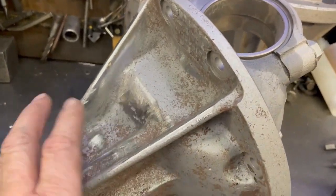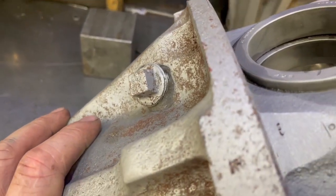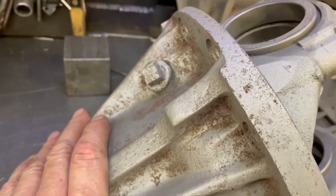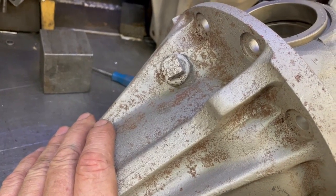We've got a different set of plates for these. Another difference is that somewhere here we have a filler plug. There are different types, but this allows you to put oil in the diff with the diff in the vehicle, without having to go through the filler plug on the axle pan.